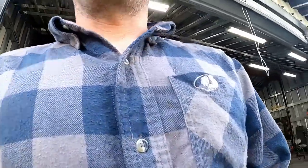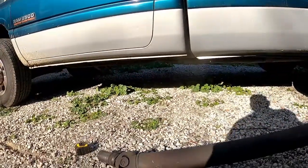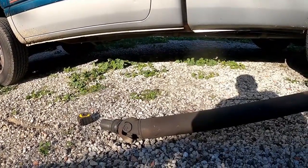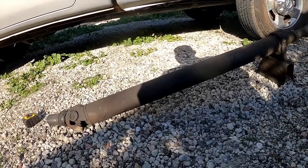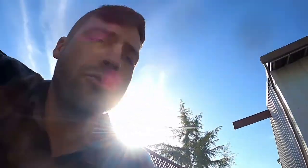I've got the driveshaft that came with the manual transmission out here and I was basically just seeing if I'll be able to use it on this truck. It looks like I'll have to get it shortened — it's about twice the length of the driveshaft that's in there right now. The good news is the mounting points for the transmission are only approximately an inch different, and the manual transmission will still land on the transmission mount.